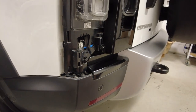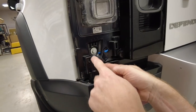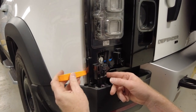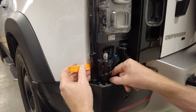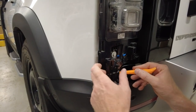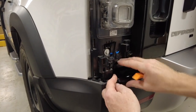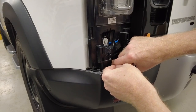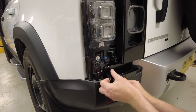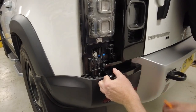When putting these back on, make sure this long prong lines up with the corresponding hole - that's the only way you'll go wrong. Now with this exposed, there is a connector here. The rear light connector fits into these two holes so you have to push it out using the little tool. Wiggle your way out and get the connector out. I've already put the interposer loom on - if you have difficulty doing that, this panel here does actually pull off to give you more room.